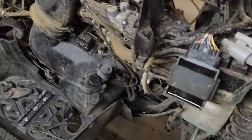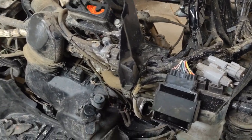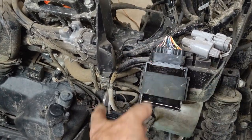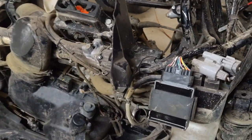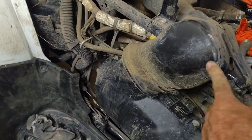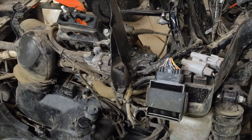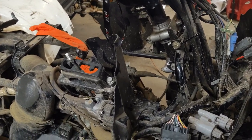Anyway, a few differences between these bikes and the older ones: the old bikes had a boot that came off here where you could tie your PVC pipe right into it. In this case, we're not going to be able to do that - we'll tie the PVC into this boot instead, which means a couple different fittings I didn't normally use on the old ones. I also have to pull off this CVT exhaust clamp here - we'll need to reuse that clamp for the boot. I'm going to line up the fittings and mock it up to show you what we're dealing with.